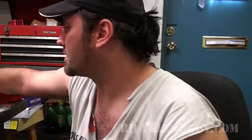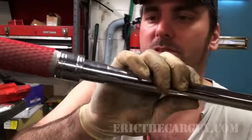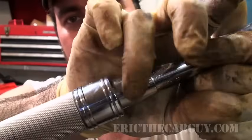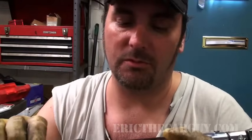Now, like most Hondas, or like most of these jobs, I've had to split this between two separate torque wrenches. So this is my big one. So when I get to 72, I'll use this one. And the reason for that is, the closer you are to the end of the scale on the torque wrench, so if you're all the way up towards the top or all the way down towards the bottom, the less effective it is. The most effective range is right in the middle of where the torque wrench is. So this one goes up to 75 pound-feet, but I need to torque my final torque to 72. I don't necessarily want to use this little 3/8 one. I'm going to jump up to the 1/2 inch one because it will give me a more accurate torque, and plus that one's longer, and the more leverage you have, the more constant motion.